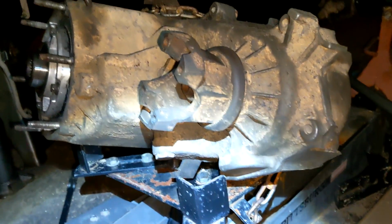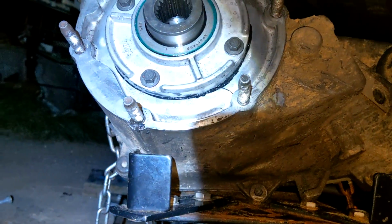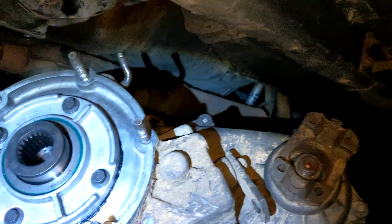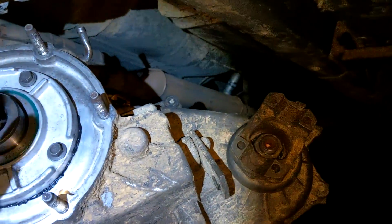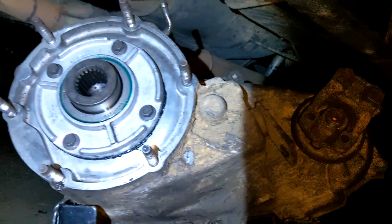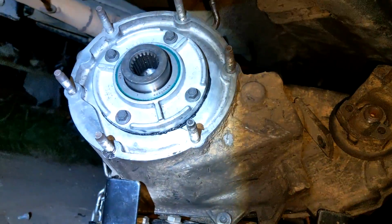Okay, great. Try to get it in position. Now it's hitting the exhaust. So, transfer case as far forward and as far to the passenger side as possible while trying to be at an angle, because you got to remember this thing's got to tweak quite a bit. So by having it lean back and kind of angulated, we don't have to move the plate as much. What a pain.